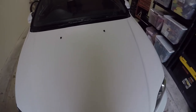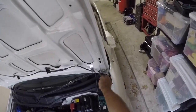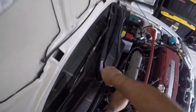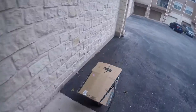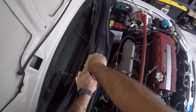So this is me just getting started changing the intake and the wiper blade arms — I'm going to paint those. I love how the EK9 has this extra hole in the hood to make the hood go even higher; it's definitely going to make this wiper arm process much easier. For these, it's just two 14mm nuts that come off.